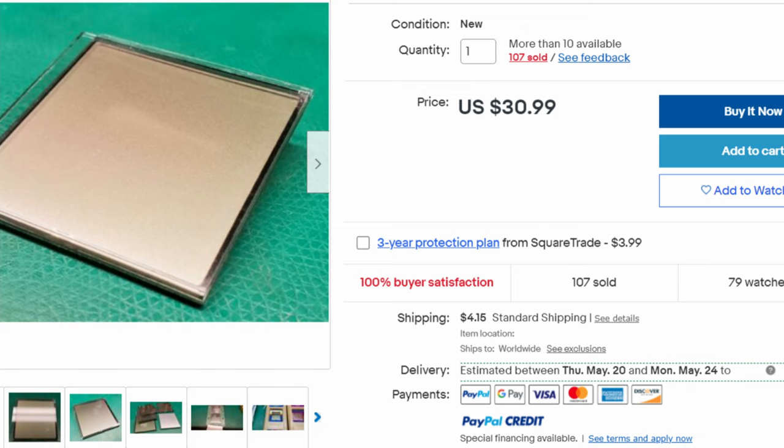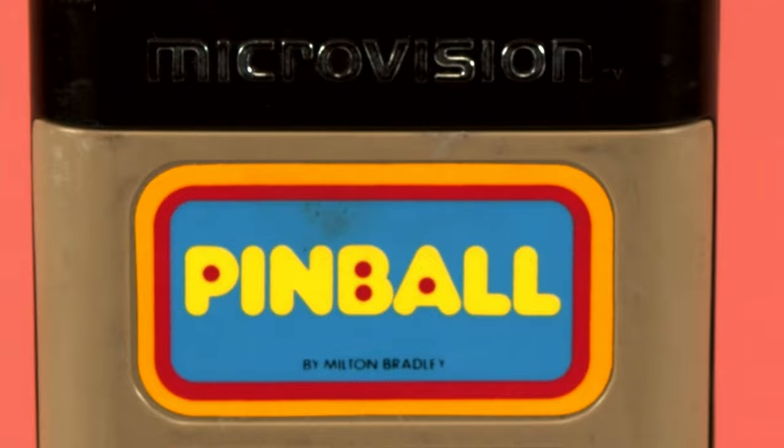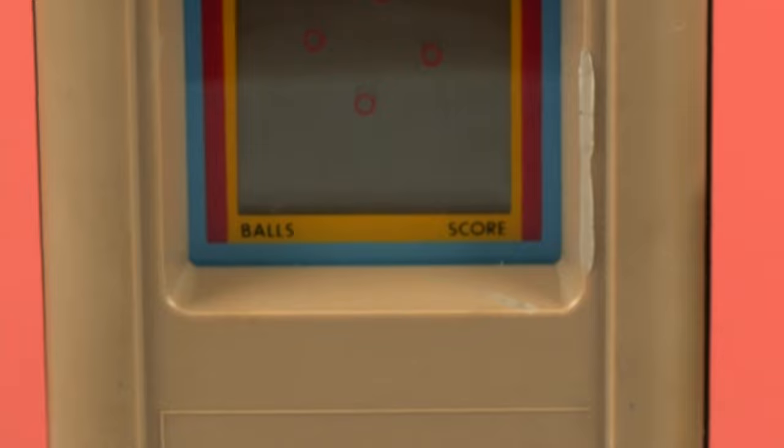The second issue with the system is keypad degradation. The screen membrane underneath the overlays degrades after heavy use. Our system has a small amount of damage to that area. In particular, I would recommend being careful pressing buttons if you happen to have long nails, since you can pierce the panel. As far as I can tell, there really isn't a great method to fix this issue.